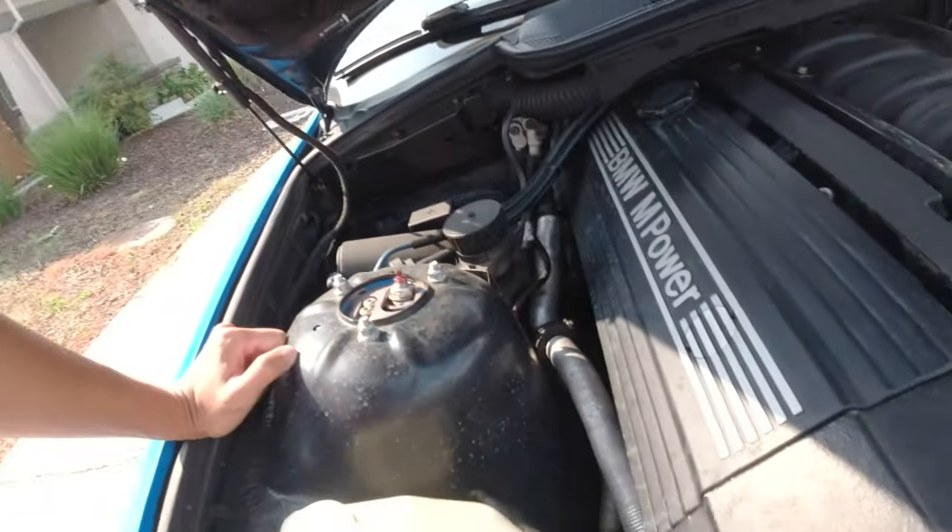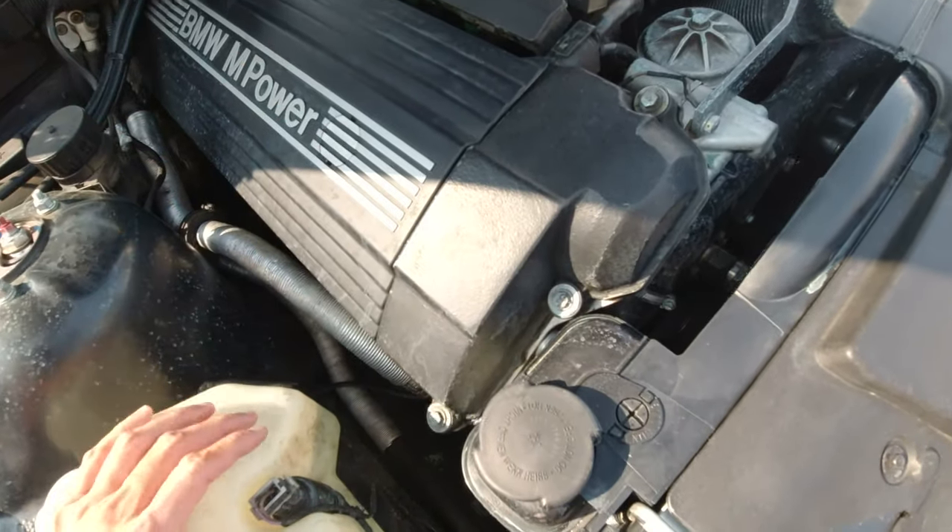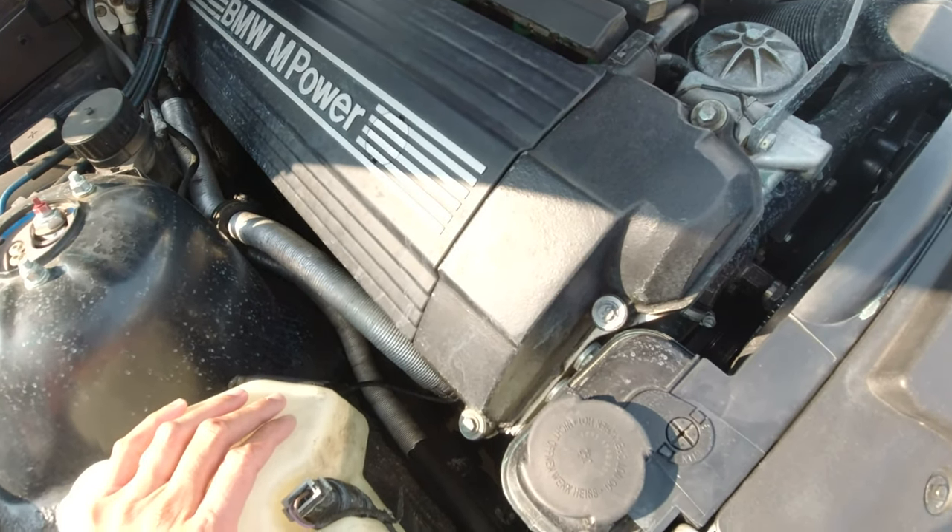Because that is just a temporary fix — in reality I actually really needed an expansion tank. I found out that the car almost overheated on Friday. I was waiting in line at a fast food place and the needle started going higher and higher, so I turned the heater on and it cooled the car back off. That was pretty much my green light telling me we need to get this taken care of. I tried bleeding the system over the weekend, left it on an incline to get all the air bubbles out, and then when I laid it flat on a level surface it started to overheat. So I opened up the bleeder screw, coolant went all over the place. Right now we're going to drain out the rest of this coolant, pull this tank out, and I'll show you what it looked like when I JB welded it and then the new part we're going to be putting in.